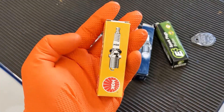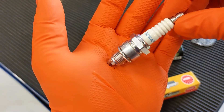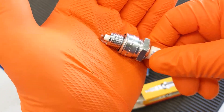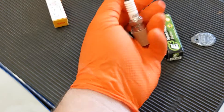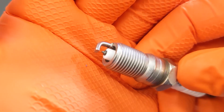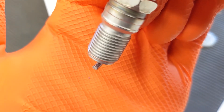Starting with the simple one — this is a regular copper NGK plug, probably out of a lawnmower or something. This is the same style plug we have in the Civic since it's just a naturally aspirated four-cylinder motor, nothing super fancy. We've got our part number, brand, a single ground strap, and a pretty decent-sized electrode. Now compare that to a fine wire plug — instead of a copper core, this is a platinum plug. This is actually a double platinum plug. The electrode is much, much finer and coated in platinum, and what makes it double platinum is there's a very small laser-welded coin of platinum on the bottom of the ground strap as well.